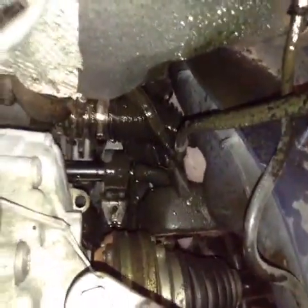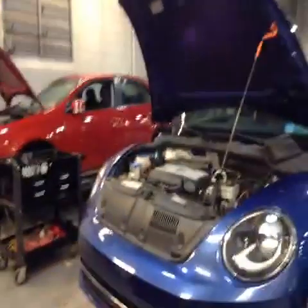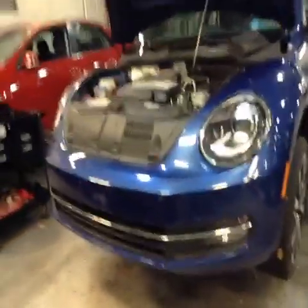If you look down here, you can see quite a bit of axle grease, because this left front axle actually has an issue seating against the drive flange on the transmission. I'm going to show you that in just a second. A few other pieces underneath are missing as well.